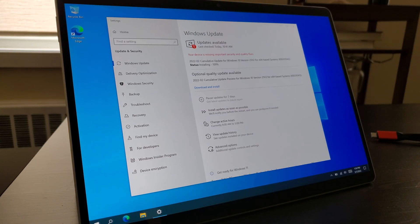At one point while running some Windows updates, it actually did give me a blue screen and just crashed — a frowny face unfortunately. I did see some firmware updates that were part of those updates, so that might have been the cause of it. After about two reboots it seems more stable. It's now just downloading one little update and hopefully that will resolve it. I do have a backup plan — I'll probably install a corporate enterprise version of Windows 10 if I continue to see additional blue screens. So if you are attempting to do this, bear in mind you may bump into that when downloading some Windows updates.